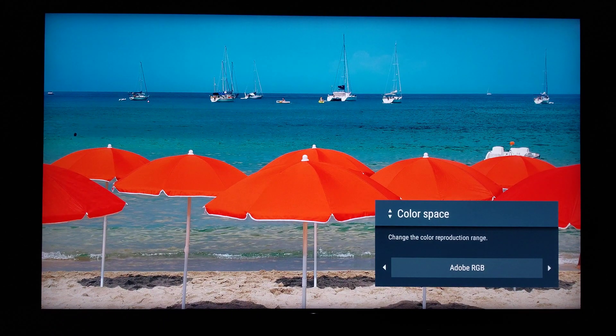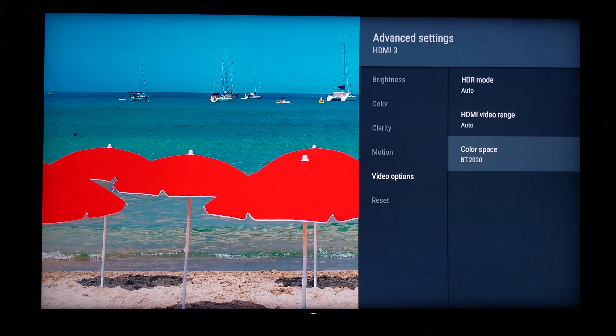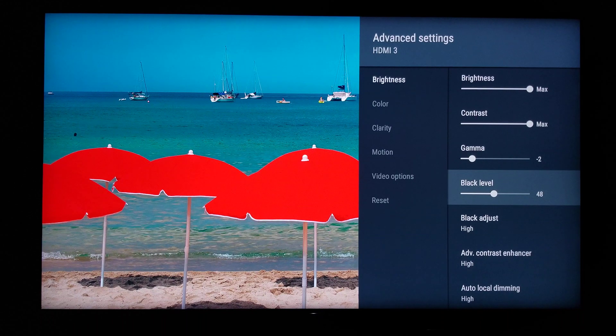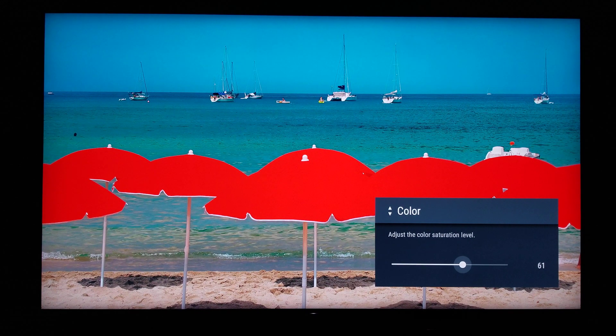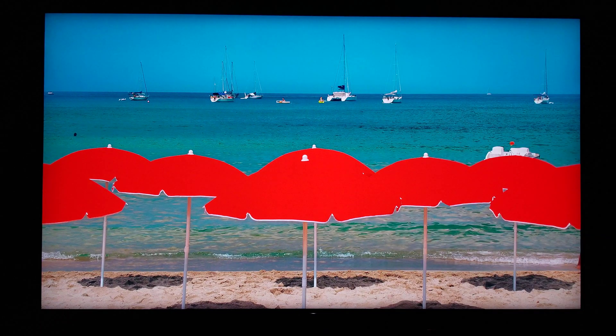Let's go back — DCI and rec 709 are not much different when it comes to these, but when you put it on BT 2020 it's just too red. Let's see what happens when I use my regular color setting and put this back. My calibrated limit on this TV is 62 but I usually put it just a tad bit higher at 65. At 65 on BT 2020, it's completely red now — you can't see anything, there are no lines in the umbrella at all. So red is really too hot.